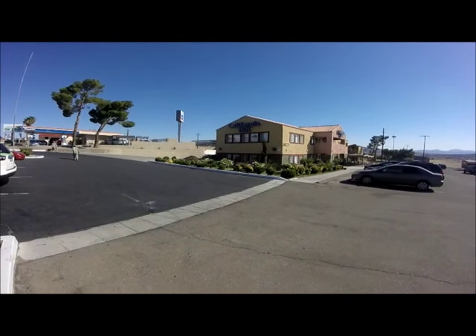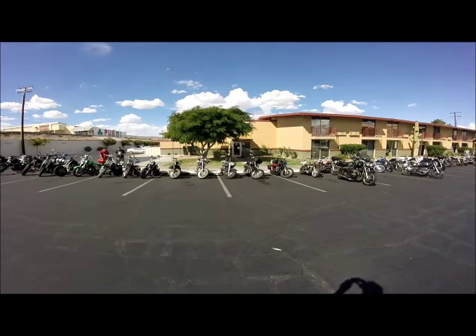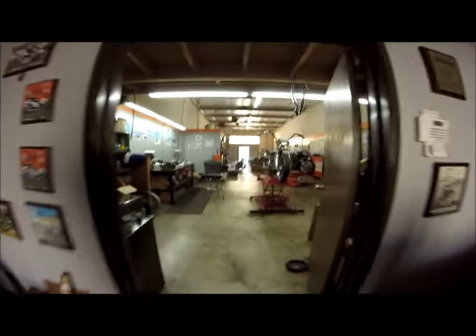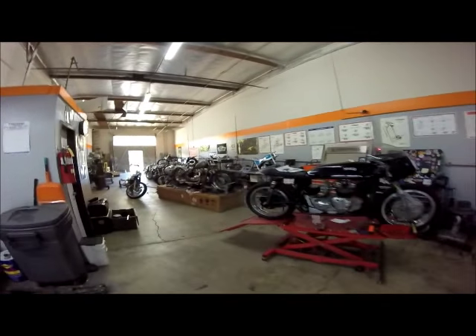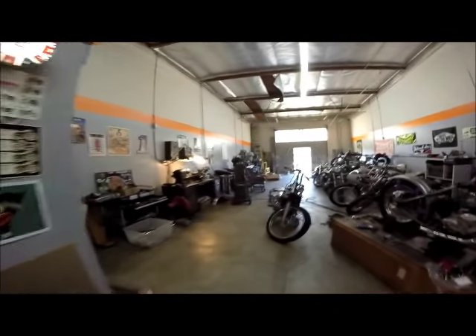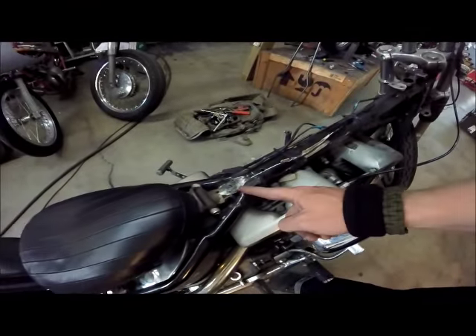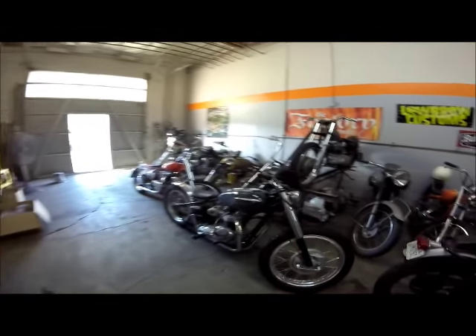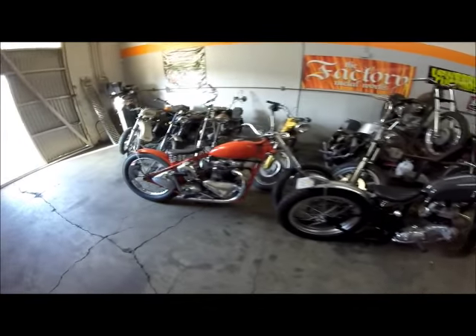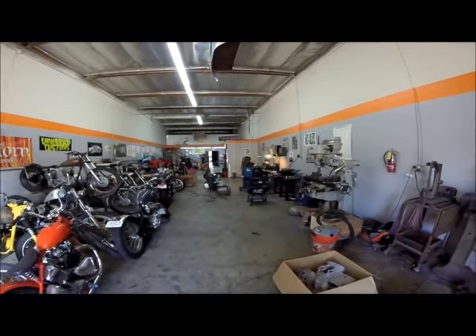This is the California Inn where we stayed. We spent a lot of time back in the pool - guys were drinking and partying. This is all the bikes that showed up, somewhere between 50 and 60 people. While I was in California, I brought my bike down to Orange to the Tiger Shack, where Ryan - one of the Born Free Builders who built that orange Triumph tricycle - fixed me up. He welded in a threaded bung into my backbone so it wouldn't start winding out anymore, cleaned up some welds, filled in some leaks, and put gussets on the back of my tank so it was pretty much indestructible. He also added a rubber mount bushing off a Triumph, so the tank is now rubber-mounted on all three points.